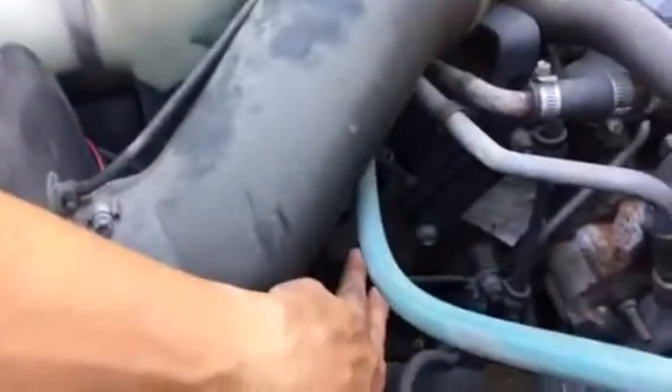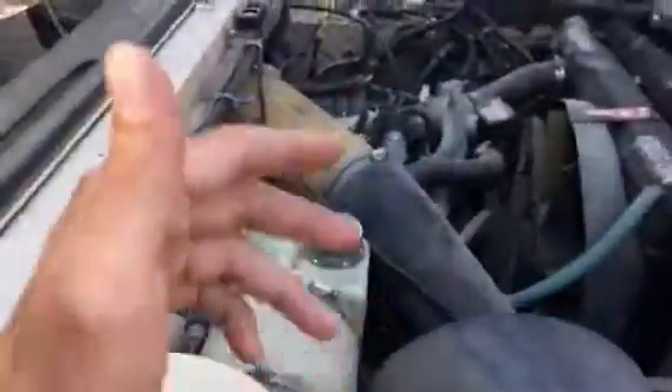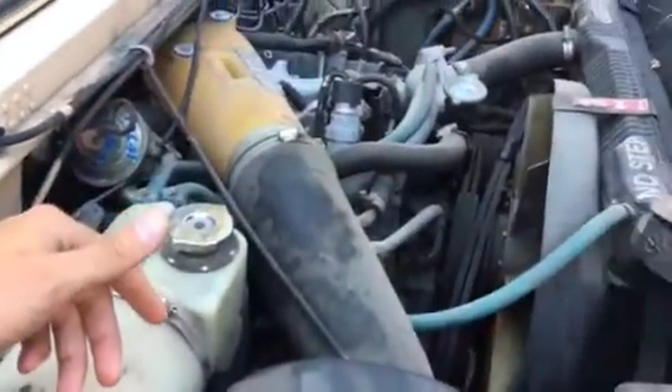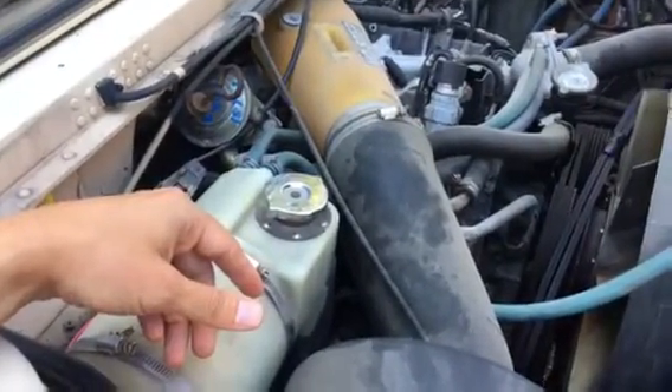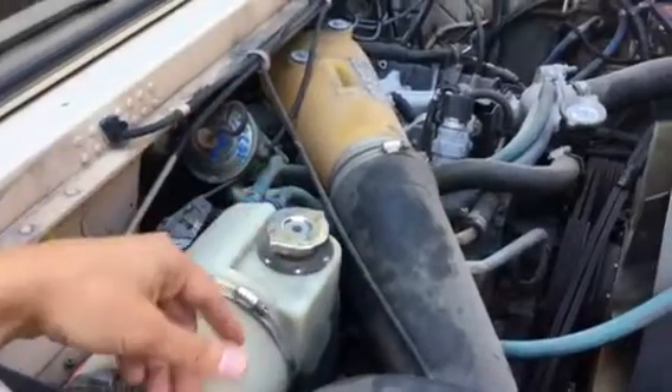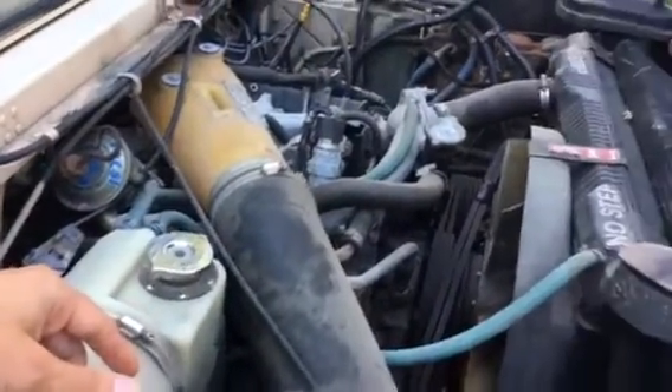On this side, you can probably access the anterior glow plug from here, but either way through the tunnel you can pretty much get to all of them — probably a little tight fit, but accessible. The driver's side bank I swapped out in 35 minutes. I gave myself a two-hour window to knock this out, which I feel I should be able to accomplish providing I don't run into any major issues. It's a pretty quick fix, but definitely something you're going to want to consider.